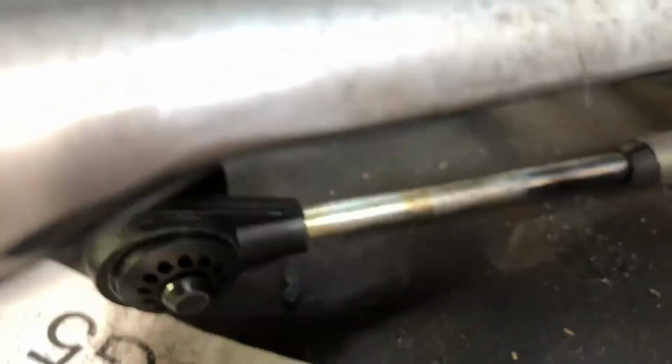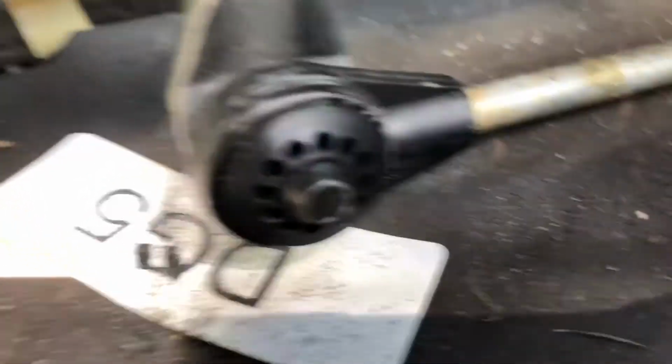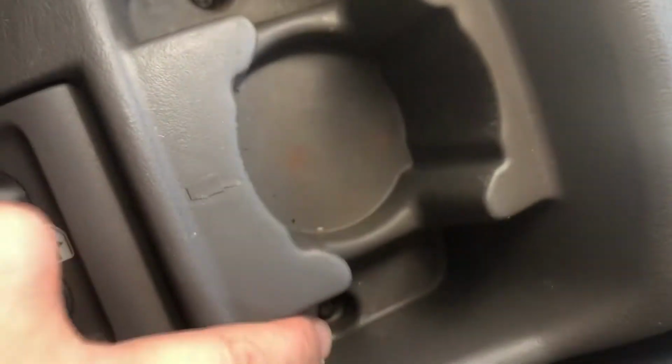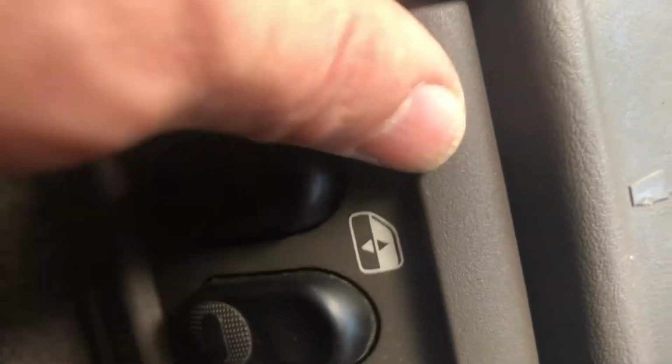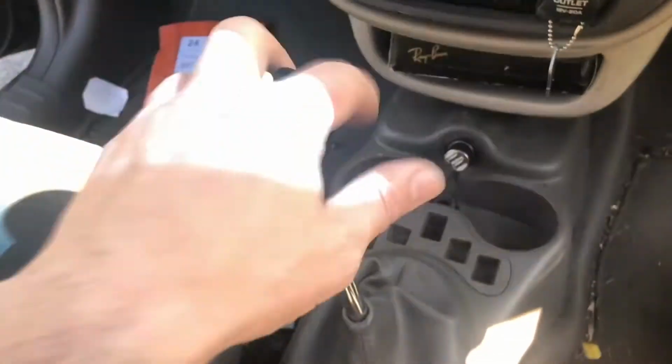But you can see now, you can hear the gears changing. So job done. Really, really quick to push that bushing in. Okay, so all done. Top tip. Put this panel back in before you push the console down, and lastly put those screws in. If you put the screws in first, then try and get this in, I had a problem trying to fit it. Took the screws out, lifted it up, this popped in easily, push it down, screws in. Top tip.